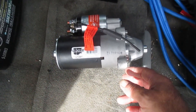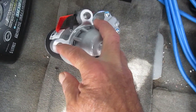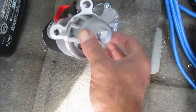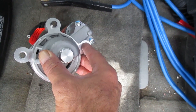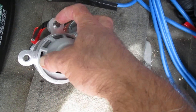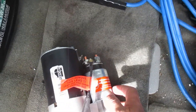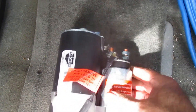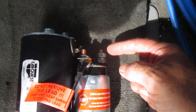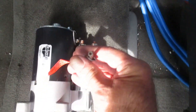All starters are basically the same. You're generally going to have two bolts — one's going to go through here, the other through here. This one has, very commonly, something to line up: there's going to be a hole there on the block for this to line up to. Then you're going to have your two electrical connections — one here, one there — and a ground wire.